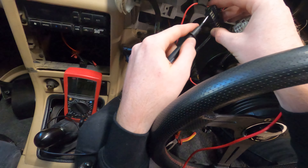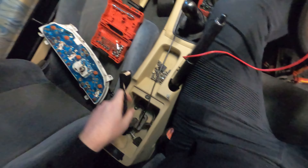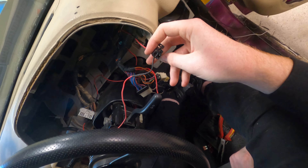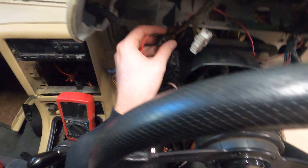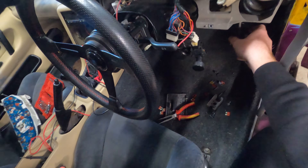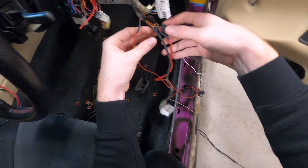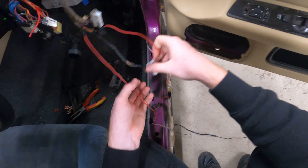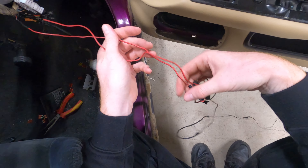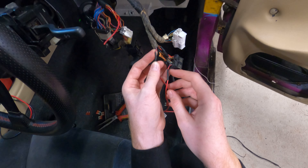If I test that for 12 volts - or whatever the battery is putting out at the moment, it's dying - and I put this on where our negative should be, I'm getting a measly six volts. I can't be bothered working out what he's plugged that into, but maybe it's as simple as just splitting those off and putting that into there. Now that I know this wire isn't actually going to anything I still currently need, I'm pretty well free to just lop that off and rewire it back onto that.